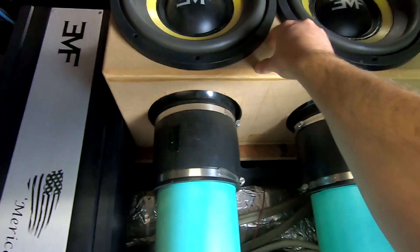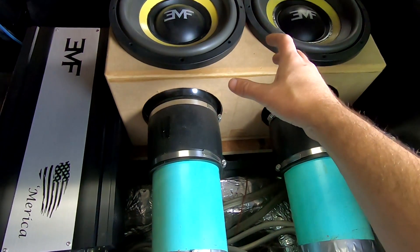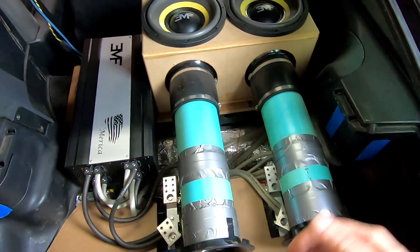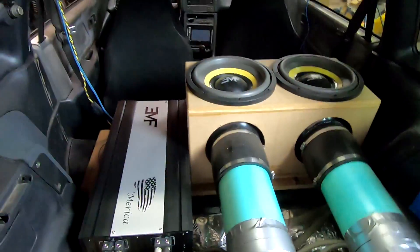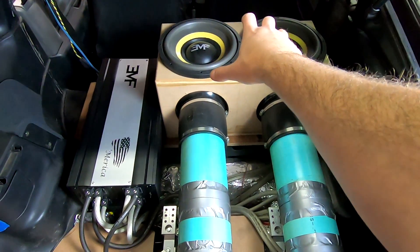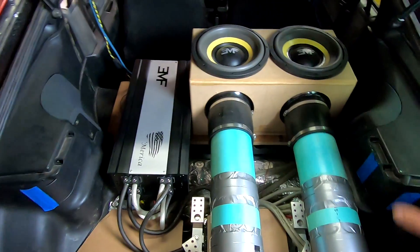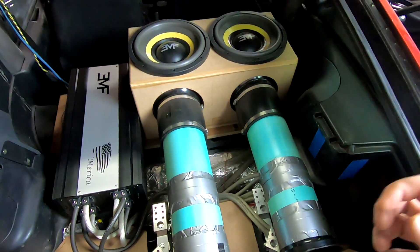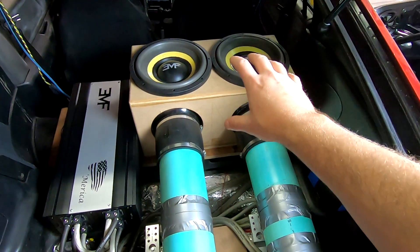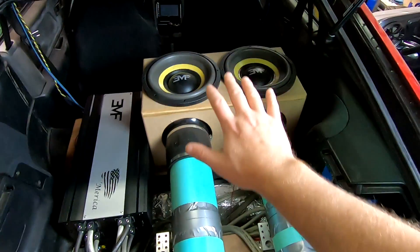So we have an enormous amount of pressure here, and all that air is being agitated, resonating through here — and that's what's giving us the tuning and the sound that you hear. In the car cabin, we're taking all of this pressure, it's resonating, and it's coming out into a much larger volume. Therefore, we can't generate as much pressure, because the woofers are still what's generating all the sound and pressure, but they're doing it in a much, much larger area than the enclosure itself.